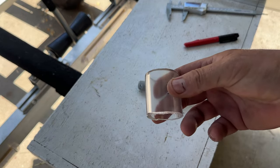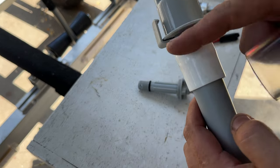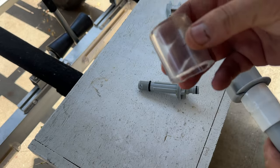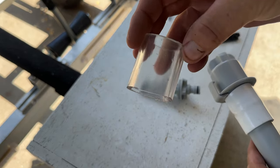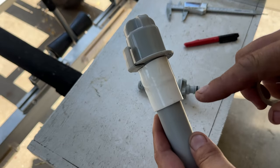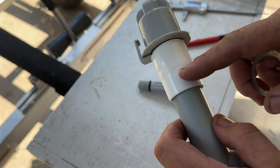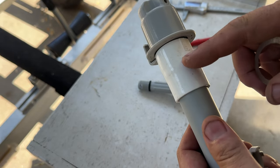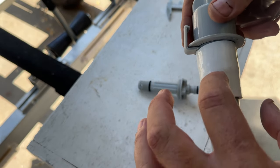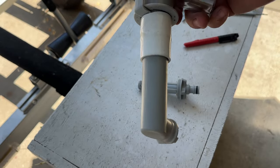I got the piece cut out. I cut off the two and a half inch section, but it had too much play and I didn't want to put any sort of hose clamp on there — I'd rather not have metal, even though it's stainless. So what I did was use a three-quarter inch coupling for sprinklers: I just heated it up with a heat gun, it stretches, and you can just fit it over both ends. So there you go — that's how I shortened it.